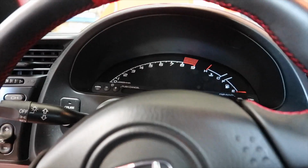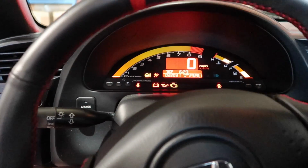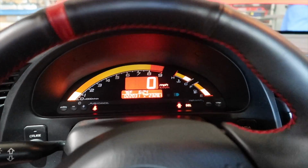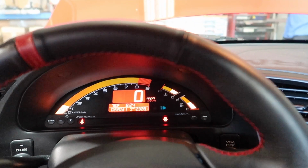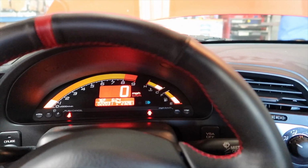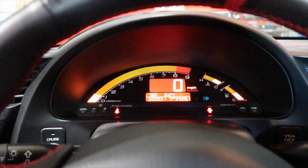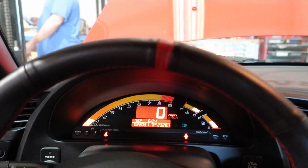Right now we just put 1000s in it with one of our tunes that we use. Watch this startup. It starts up like stock, absolutely crisp. Really, really good injectors. We use FIC 1000s, and the atomization on the spray pattern makes just such a massive difference. Doesn't bother it at all. Idle is solid,